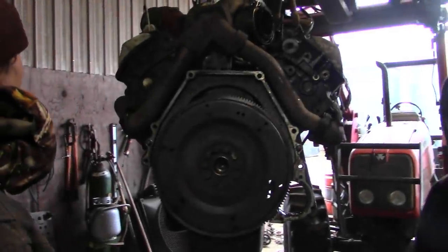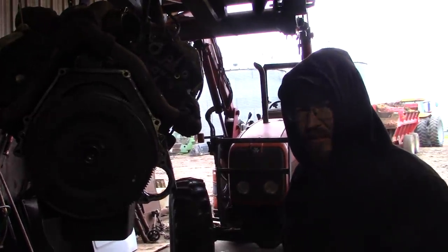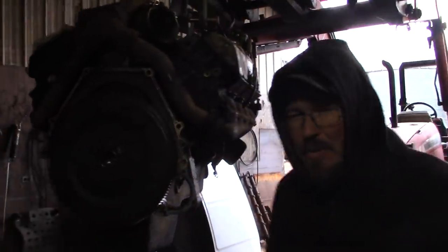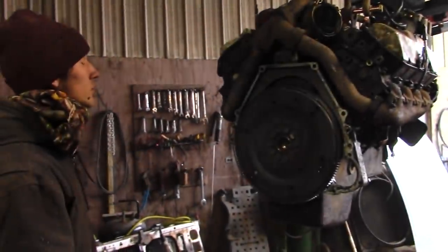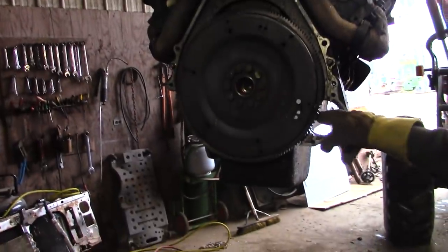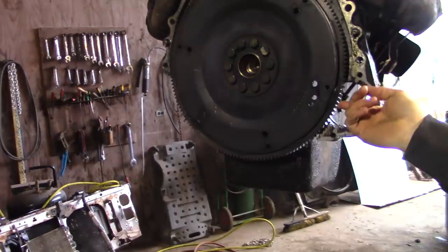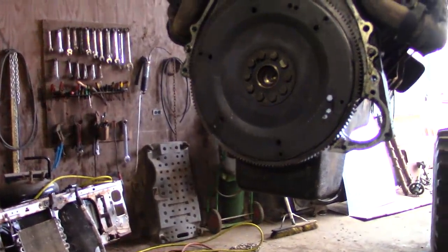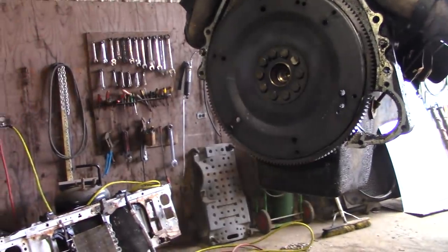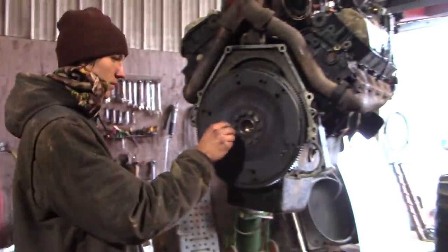What just happened? Did I miss something? No, we're discussing what to do. No, I mean, it's not on the stand. You don't have the right bolts, so you go to plan B. Oh, okay. Your starter goes in here, and when you turn your key, the throws connects with these teeth, and then spins your motor over, and that's what starts it. There you go. It's your flywheel. And this is a little one compared to what's in the... It's pretty big compared to a lot.